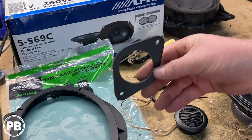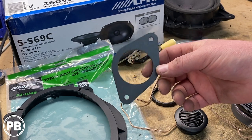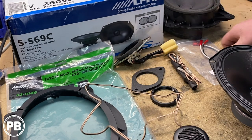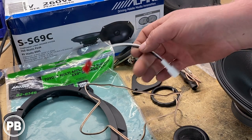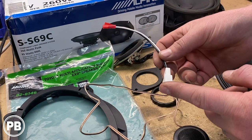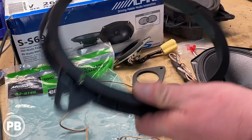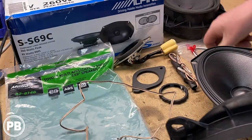To accommodate the tweeters in the dash we have these custom ABS dash brackets — we'll link these in the description. This is for a two inch hole cutout, which is perfect for an Alpine tweeter. To accommodate the wiring in the doors we have wiring harness adapters, the Metra adapters — again linked in the description. These plug into the factory plug in the door and wire up to the new speaker. First we need to get our 6x9 mounted into the bracket and prep our wiring for the door, then we'll turn our attention to the tweeter.